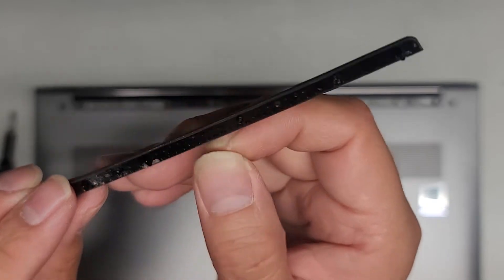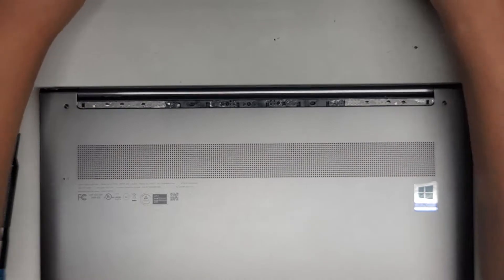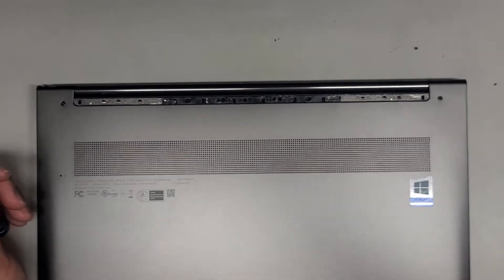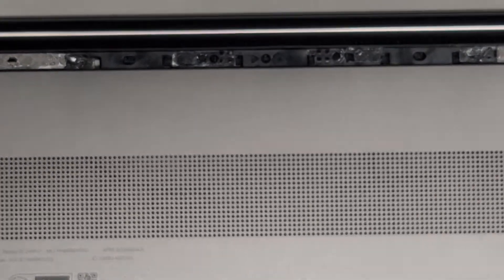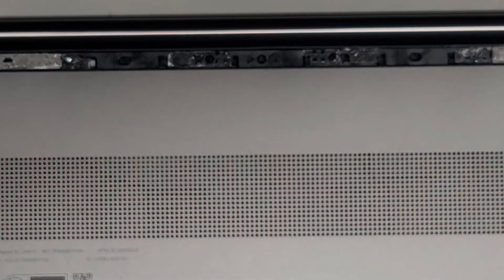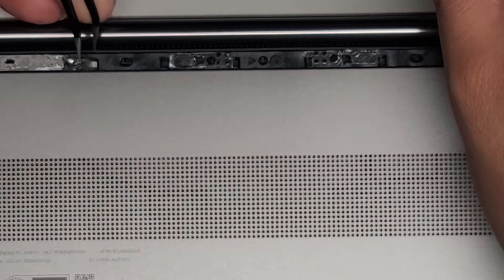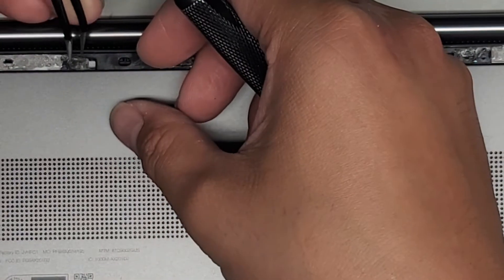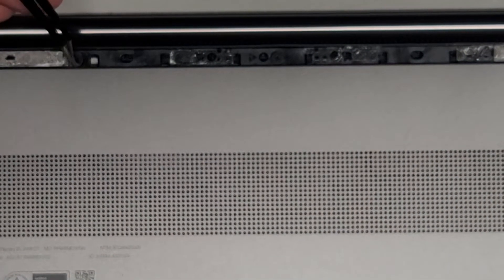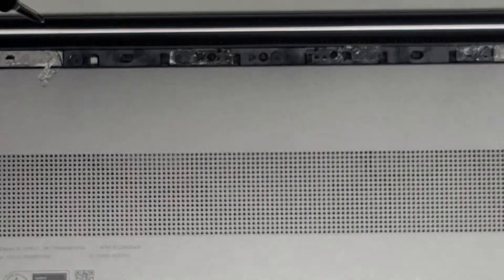Try and keep the adhesive in the right way. Once you remove that, you'll see there are some screws hidden underneath. Let me zoom in — these are PH1 or JIS1 screws. There's only three of them. They are a little bit tricky to get out if the adhesive's kind of getting in the way, so you do want to peel this up a little bit. You can peel it up and fold it out of the way, or if you want you can even just cut the adhesive, because you don't really need all this adhesive.